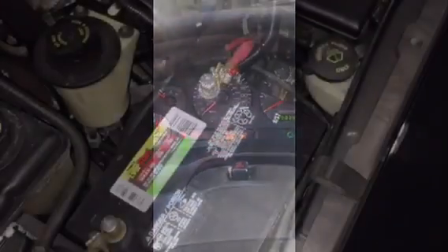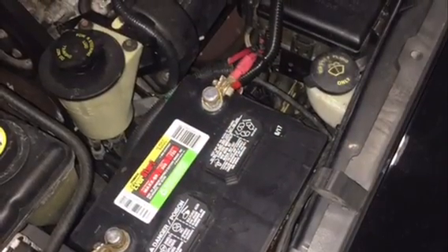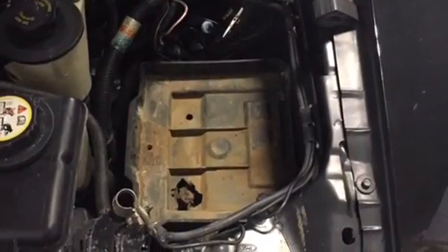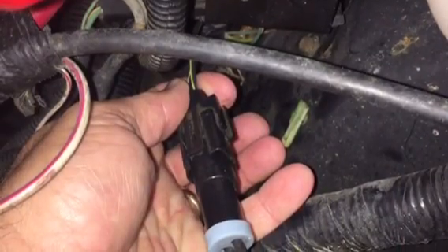After a lot of research, I determined this was a grounding issue. To fix this, remove your battery and you'll see your battery tray. These cars are notorious for collecting water at the battery tray — it holds that water and it sinks into a ground connection right beneath your tray.